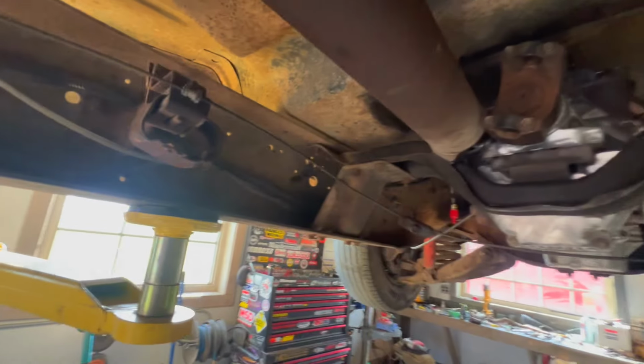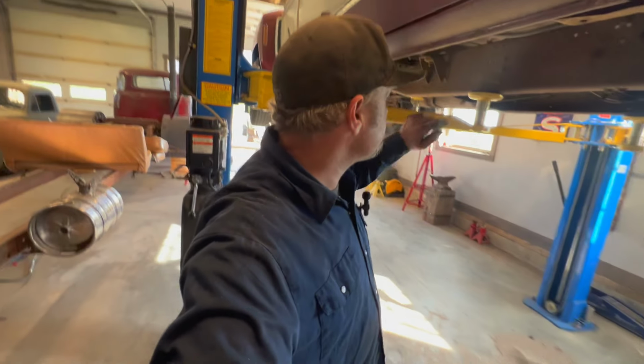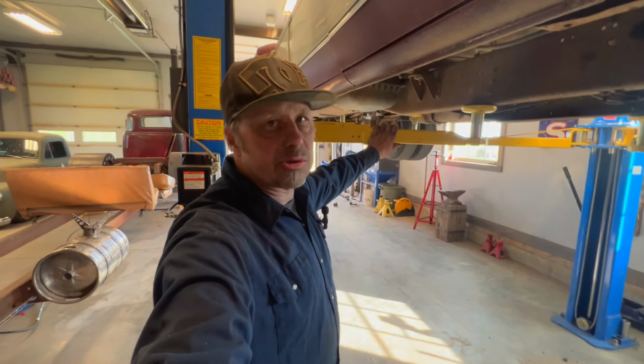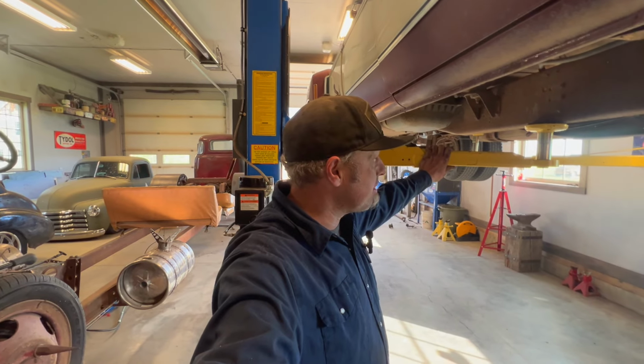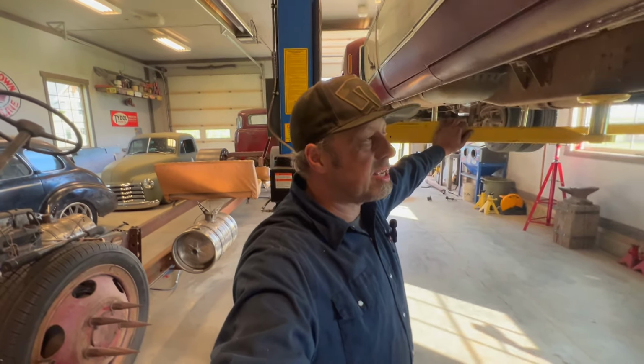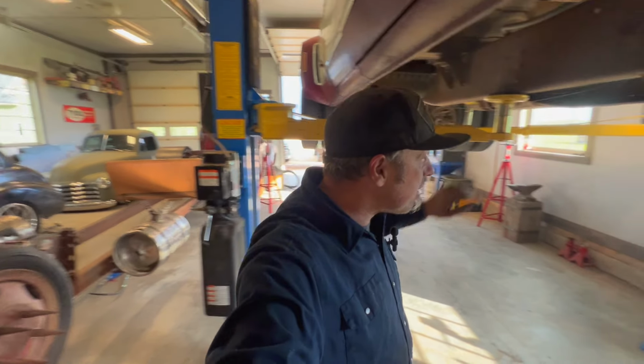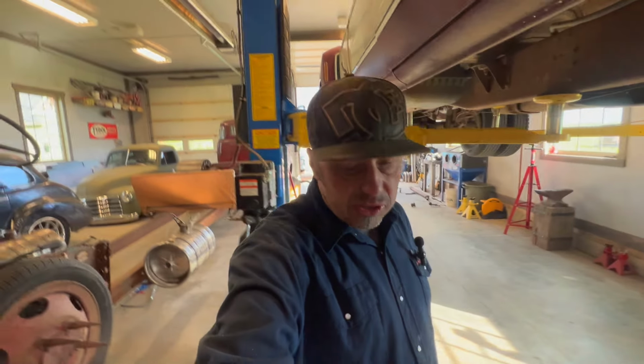So I got my steady bearing mounted up. Double check that. But yeah, I'm going to have to shorten that drive shaft. I'll get a tape measure, but it's looking like maybe 2 inches. So I'll measure that for sure, and we'll get that baby shortened. And I did mention before, but I've got to see if I can get an offset U-joint so that it couples to that yoke. And then we're laughing. But I'll leave that for now. That's no big deal because I'm going to measure that up.